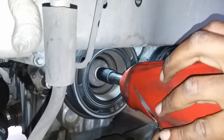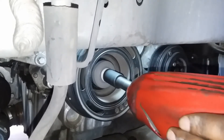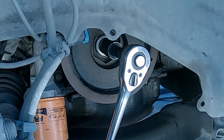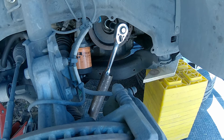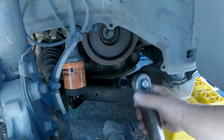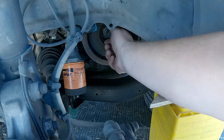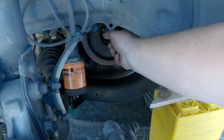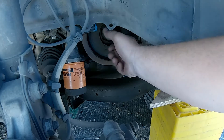The second method is to use a powerful air impact wrench to remove the bolt — these do quite well. Or three, let the motor do the work to remove the bolt. I chose the third option as it's easiest when you work alone and don't have an air compressor, but it does require good tools and a clear work area. Position the wrench against the front suspension lower arm; a cheater pipe may be required if your wrench doesn't reach all the way securely. With the socket sitting fully on the bolt and everything clear of the swing of the wrench, get in the car and bump the starter. It may take one or two bumps, but this will loosen the bolt so it can be removed by hand. Use caution with this method — everything must be planned out before bumping the starter. Anything in the way of the wrench will be damaged, and if the wrench is thrown by the motor, it can cause damage or even injure someone nearby.